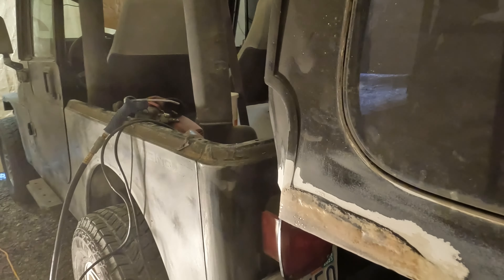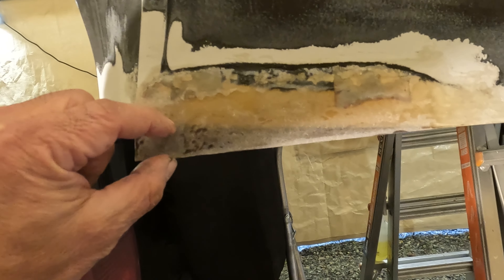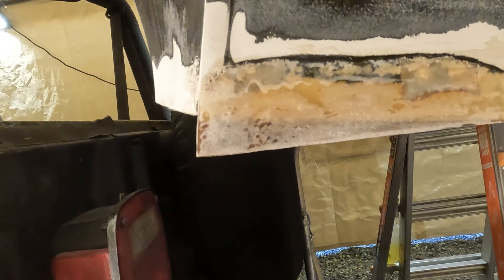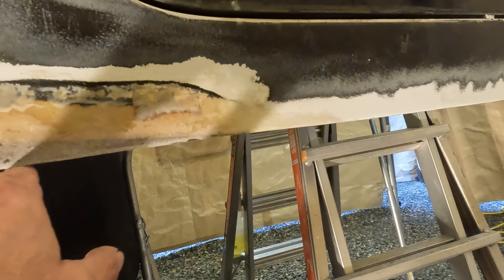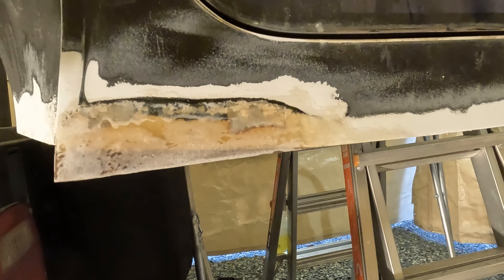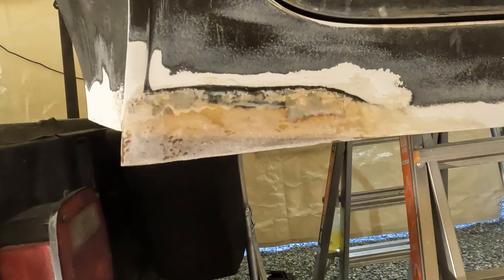I've fiberglassed the sides and sanded it down with some 36-grit. You can see where the edge was up here — this area here is the piece of cardboard that I put just for the shape, and then fiberglassed over that. So the shape is back where it belongs. I used a level to align it with the rest of the edge of the top. I'll put on a thin coat of light body filler just to take out the imperfections and sand it smooth, which sands a lot easier than fiberglass does.